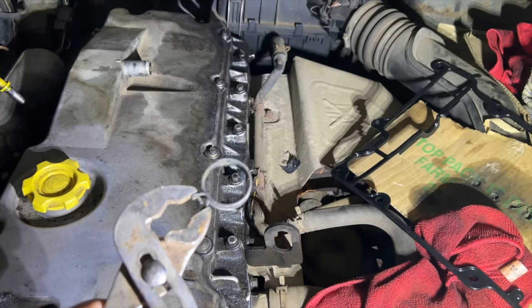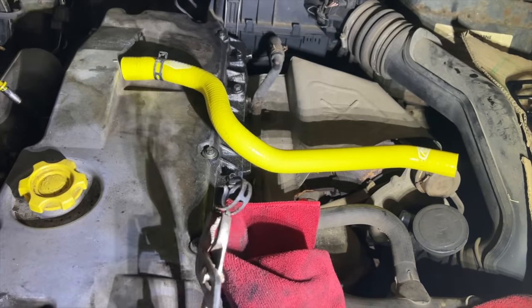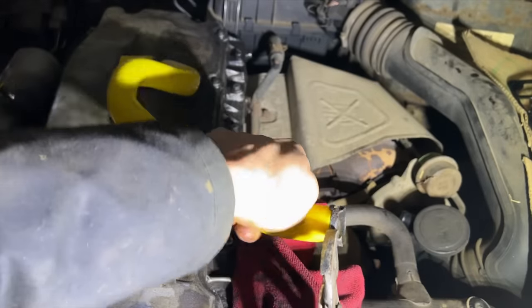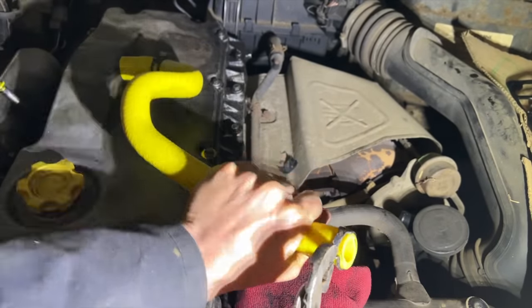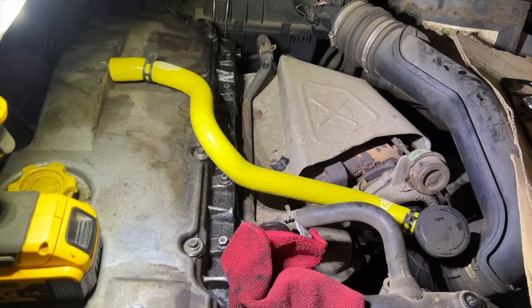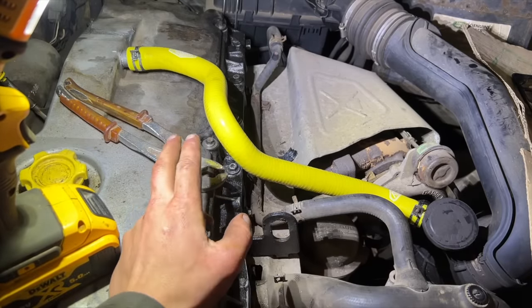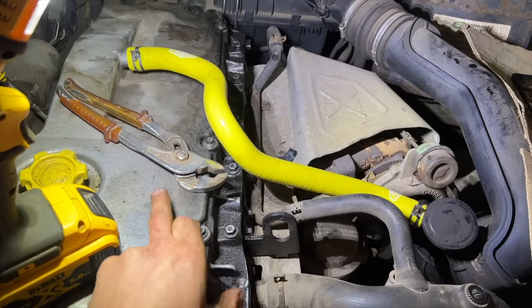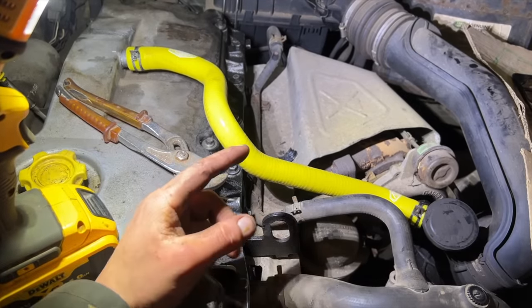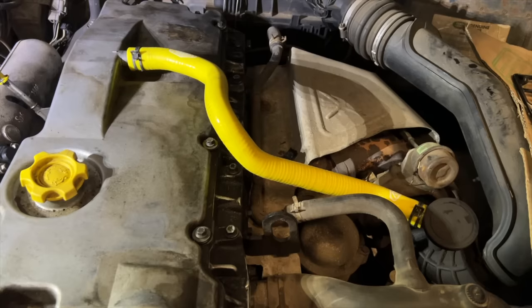Please don't go flying. Also don't want that to rub — might make up a wee bit of a guard for that pipe, because that's gonna rub on there like the last one did. I actually don't think doing the injector shields on this is going to solve the problem of my Defender not working. The guy who was chopping up logs for us the other day used to work for Land Rover for eight years — he said make sure and try the filter head. He said that's a very common one: filter head, air getting in there. So I need to order a new filter head. We'll see if it works from this, but I don't think it will — order a new filter head, fit that.